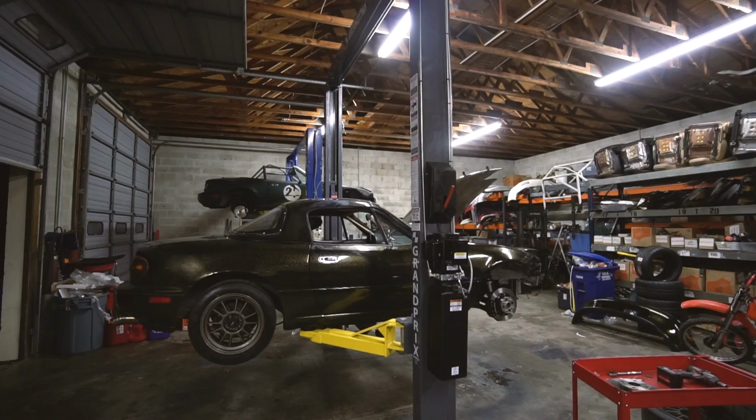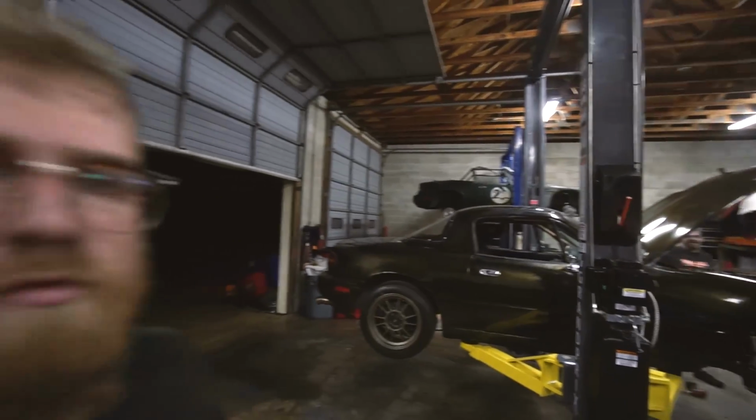So much nicer. Change of plans number 3 or 4. I don't even know how many times I've changed the plans now. We are gonna just go ahead and throw the rear calipers on. I don't care to have to rebleed the whole system like Tuesday night before the race. I might still have to for the master cylinder. It didn't end up showing up today. Either way, it's kind of in a tough spot, but the way you're thinking about it is, if I had made my handbrake the way I wanted it already and it was just switching it, it'd be one thing. If I had the other caliper and it was just throwing in a different handbrake for the time being, one thing. But to do both just doesn't make sense.